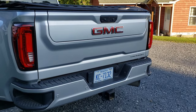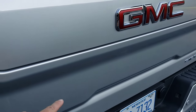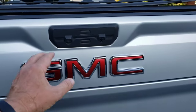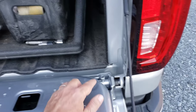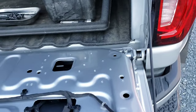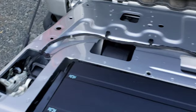There's our project — we had the bumper down and had the tailgate down. We didn't have to paint the top piece; we went with this piece here and it matched absolutely perfect. I think in most cases if you damage the lower part of your tailgate you're not going to have to redo this and put new letters on. When you take these tailgates off, you do not have to loosen this screw up here — it's set against the flat side of the torsion bar. The main thing is just make sure you stick this black plastic piece from the old tailgate back into the new one and it'll go down nice and slow.